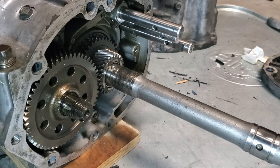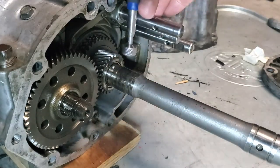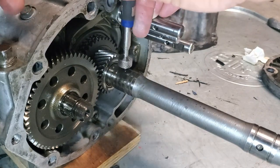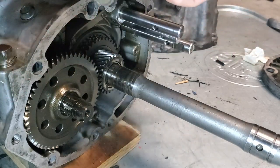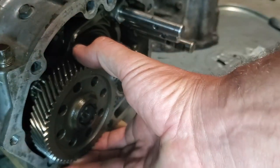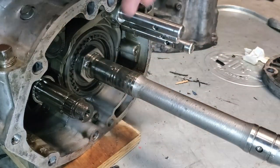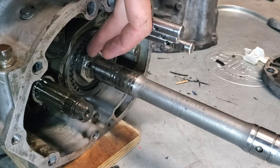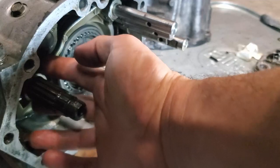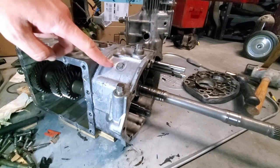Now we're going to remove the fifth gear counter and fifth gear. There's a steel pellet right here I want to remove with a magnet - there we go, this should slide right off. Here we've got the 41 millimeter socket that we're going to custom make to get this off, and we've got this little shim right here that pulls out right behind it. Then we're going to remove this 12 millimeter set bolt and seal washer that holds the counter reverse shaft in place.